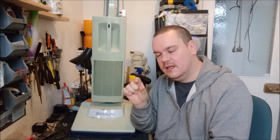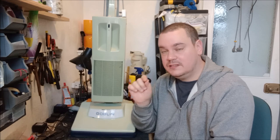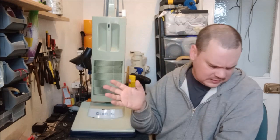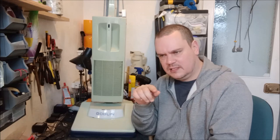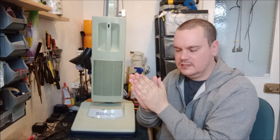And I thought, okay, I need to pack the bearing in its hole. So what I did was, I got a compression washer, which is basically the kind of washer you would have within a Hoover brush roll. It's a little washer that's kind of U-shaped, so when you press against it, there's tension there. So imagine that you've got the motor end frame, you put the bearing in, you put the compression washer in behind the bearing, then put the cap back on, rivet that back into place.